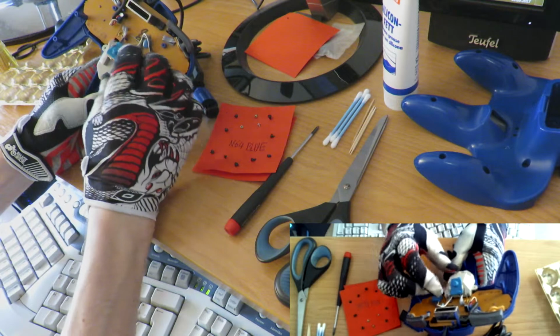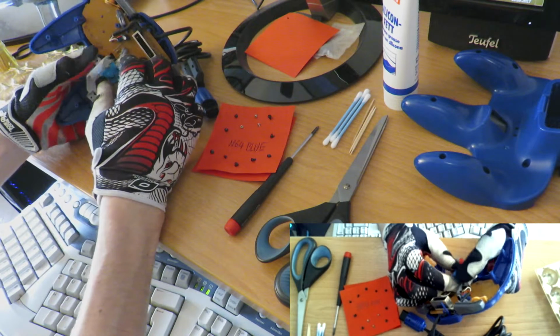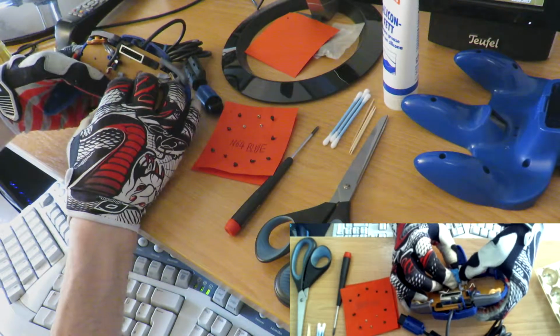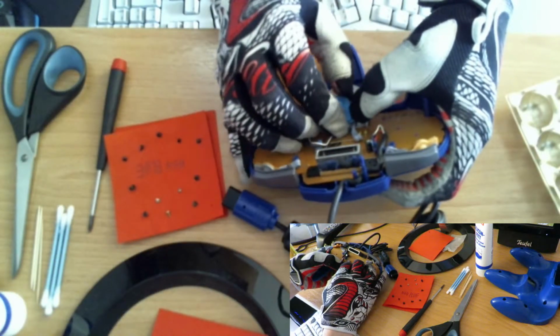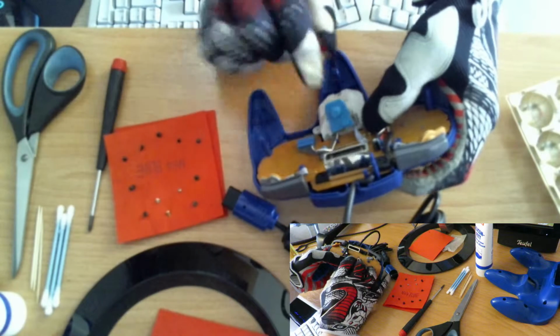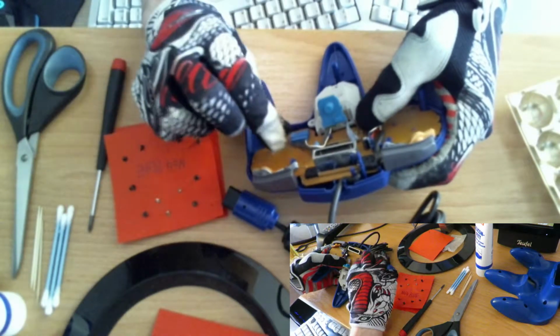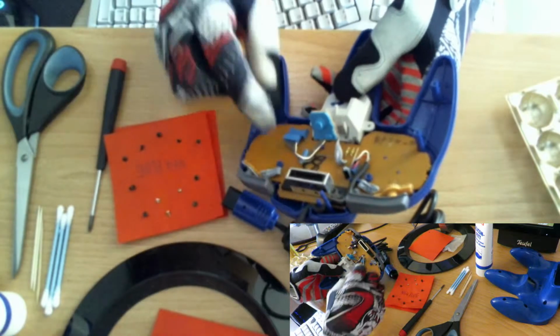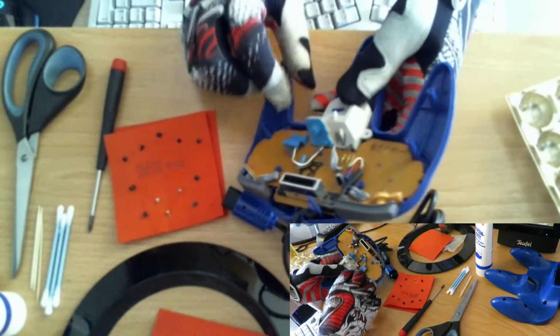Also here I removed the screws and put them into the paper to avoid losing them. Carefully remove the Z button, do not break the plastic. Then the cable plug, go with your nail and lift it a bit on the left and right side. This should work.